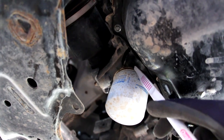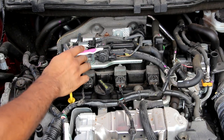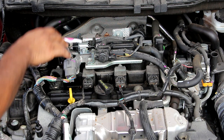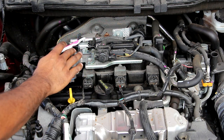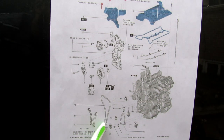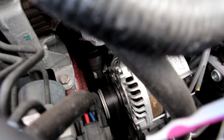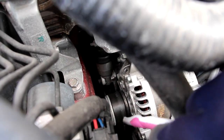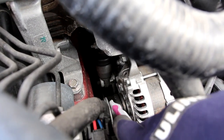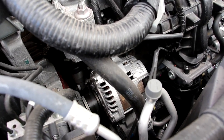There's no integrated oil cooler above the oil filter like on many other vehicles. Underneath the intake manifold there's a plastic oil separator to keep oil in the crankcase, and above that is the PCV valve that ventilates it to the air intake. There's a mess of vacuum switches at the top — one for the purge valve for the evap system, and another that controls a valve in the exhaust manifold to vary the airspeed going into the turbocharger for better control. The CX-9's engine has a double overhead cam design powered by a timing chain, so you don't have to change it over the life of the engine. The drive belt setup is in front of that, with the belt going to the alternator and tensioner, and it's best accessed from below. I do like that the alternator is easy to access without removing the AC compressor, unlike many other front-wheel-drive four-cylinders.